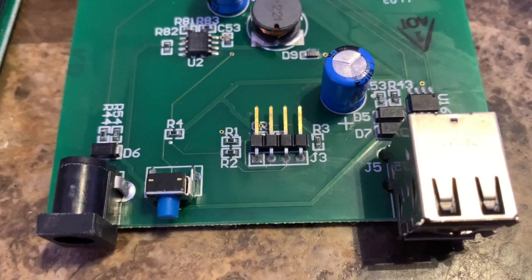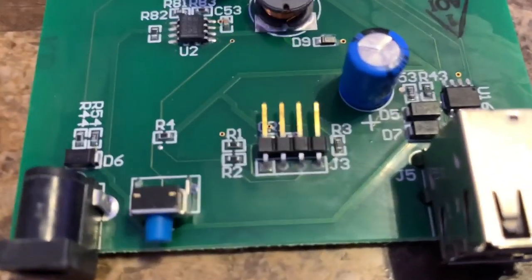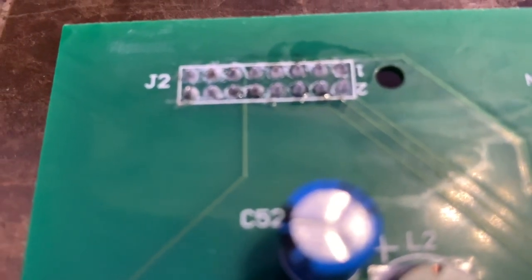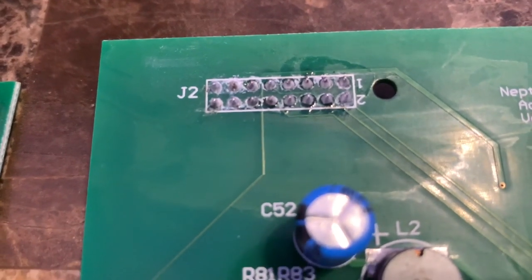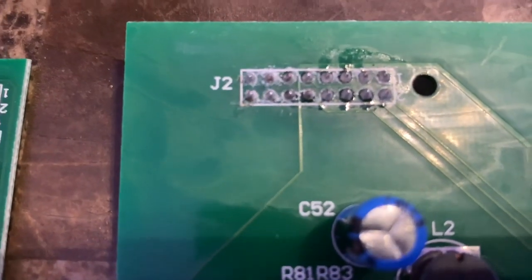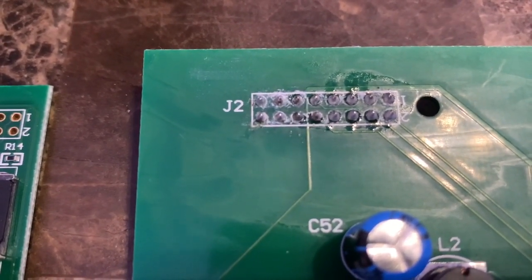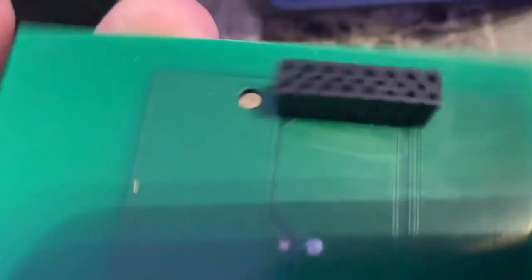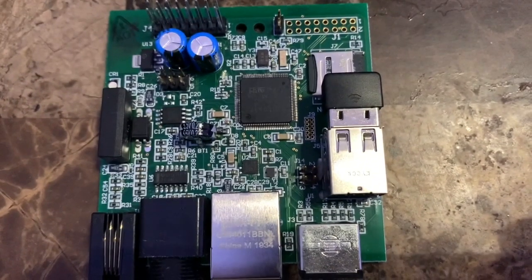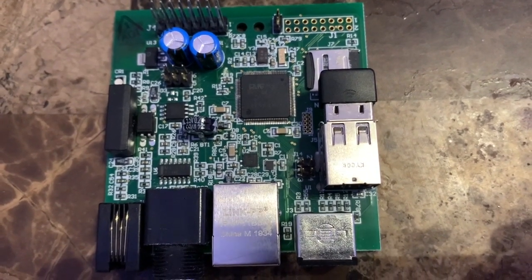So what I did — I got some rubbing alcohol before all this COVID stuff happened. Almost 100% rubbing alcohol, and I cleaned it. The reason I use rubbing alcohol is because the alcohol will evaporate any water. I think I did a decent job. I used Q-tips, cleaned up all the terminals as best as possible. You can still see the salt there, but I went over it and over it and cleaned it. Before, after the rice and drying everything out, it wasn't turning on, but afterwards from using the alcohol it did start turning on.